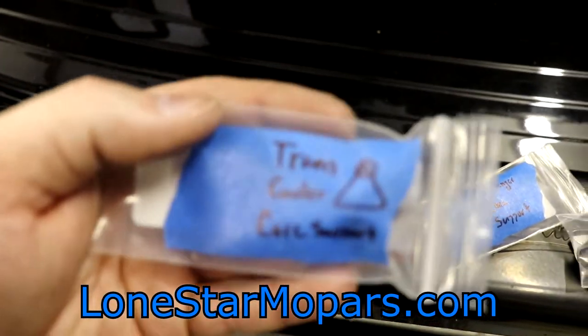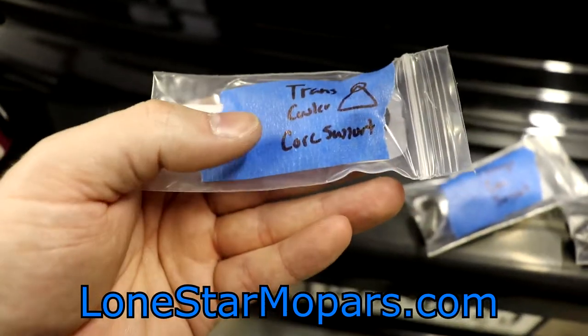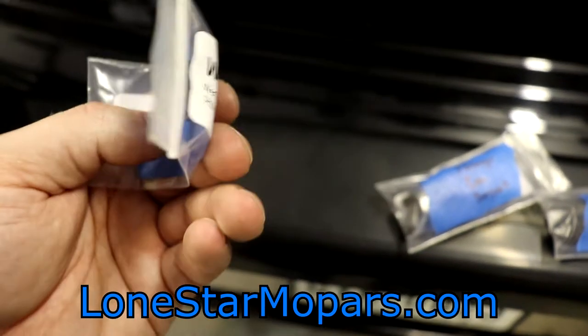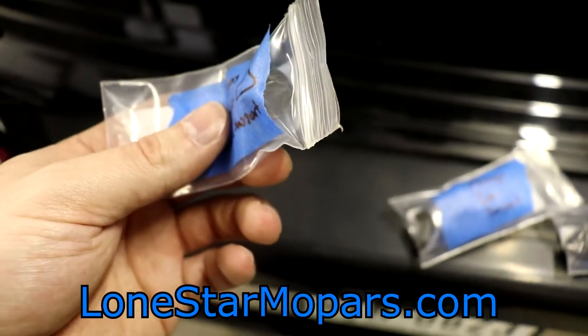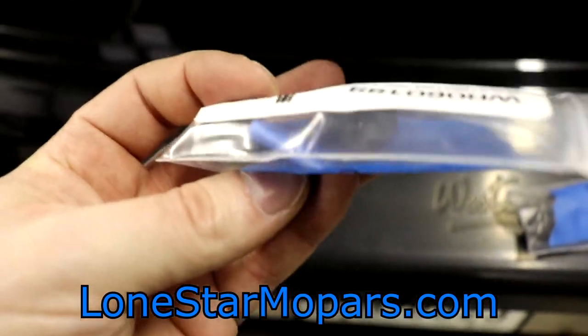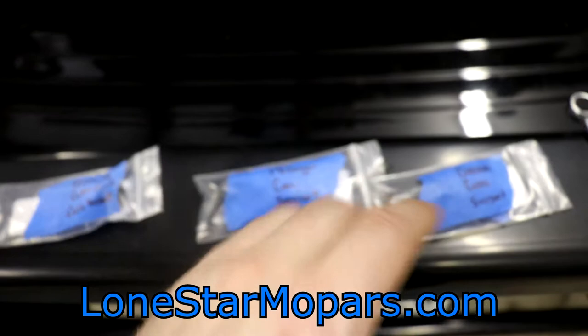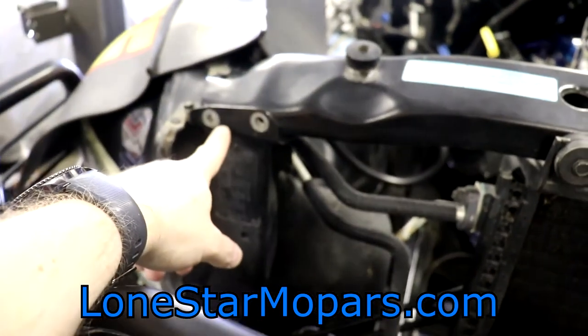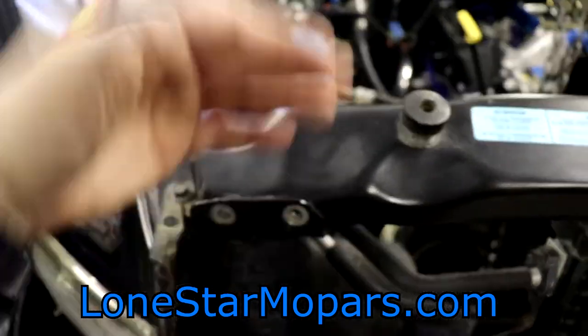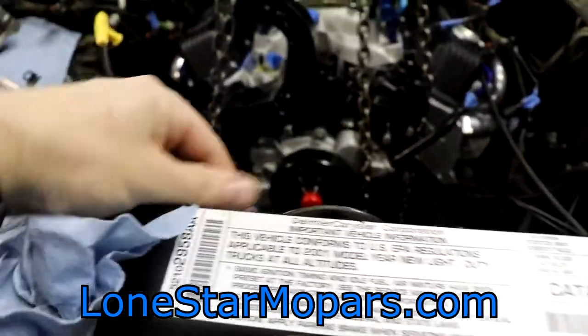Sometimes I do actually say what I do and do what I say — bagging and tagging stuff makes my life a lot easier. Trans cooler core support — I did my drawing so I know exactly what it is. This looks to be an M8 by 20 millimeter with a crown head and a fixed washer — not a loose washer. Keep that in mind. If you acquire a truck missing the core support, it's the same M8x20 on both the passenger and driver's core support. Driver's side you've got one, two, technically three. I want to get that bracket in so I can pull that bolt, see if it's the same size or something different, and then I'll know what to order for this side.